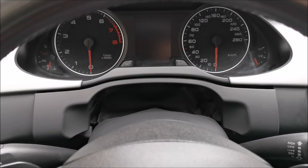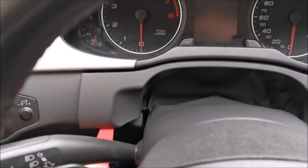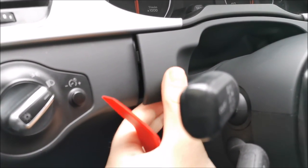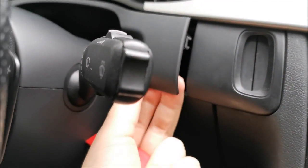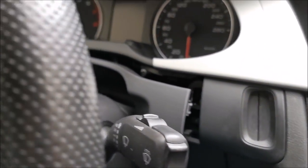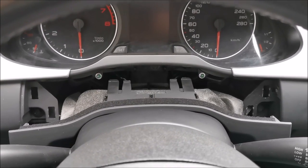I put my steering wheel as low as it can go, and with this particular tool I went beneath the trim and pulled on it like this with a bit of leverage, to undo this particular clip right there. It's about the same on the other side. You start from the bottom and go all the way up — there is your clip. At this point this particular piece should break free and we just let it down; it doesn't bother you when sitting like this.